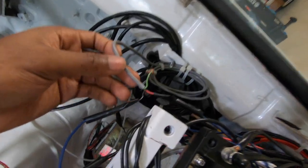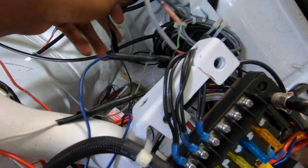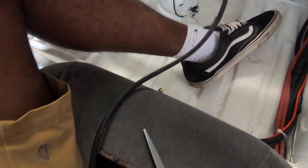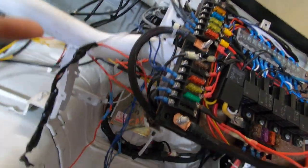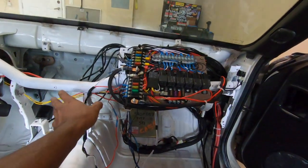The way I routed the wires was kind of rushed. This whole harness right here is for my tach, and if you look up here you can see all these wires going different ways — there's one wire that's like under that red wire. Basically I'm going to disconnect this from the ground, run it the right way, and extend this loom. You can see how neat it looks when it's loomed, but when it gets to the end the wires get all messy. I want them neat like my ground wires and switches which are grouped together.